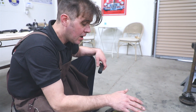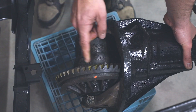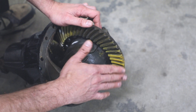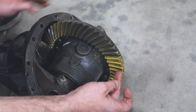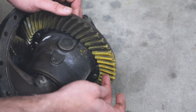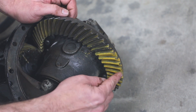All right, so now we're back here at the chassis. What we're doing is we're looking at the third member right here. You'll notice the markings on here — this is how we checked the ring and pinion. We did it a few days ago, but going through and checking everything, we want to make sure we have a nice cigar shape that this paint identifies as it goes through, so that we're not having any odd inflection with the ring and pinion here. So this is a little check right here.